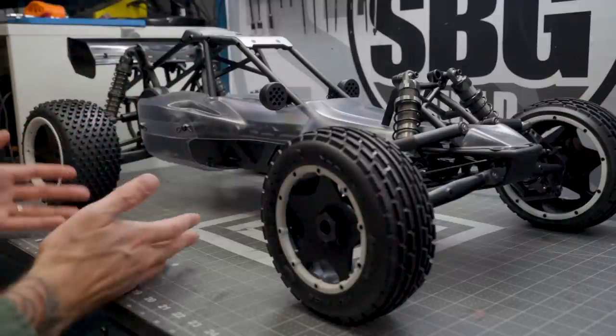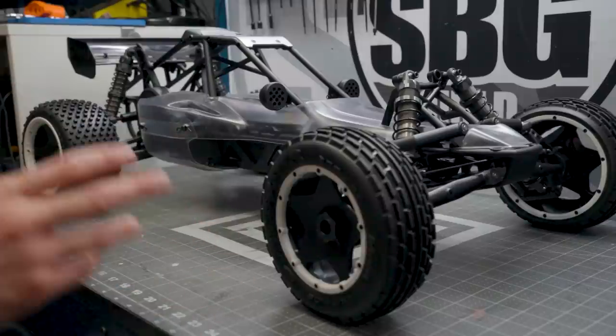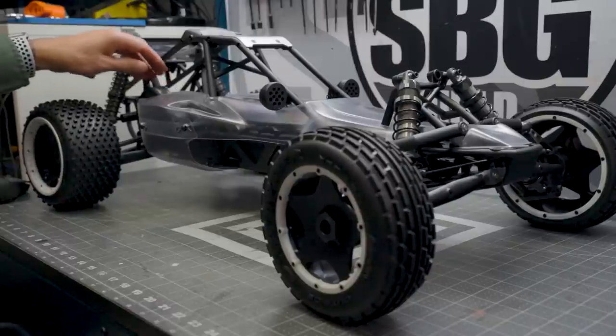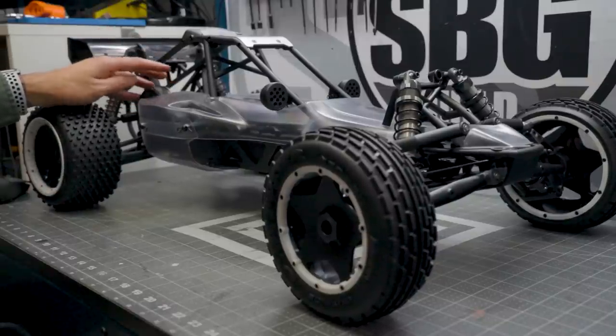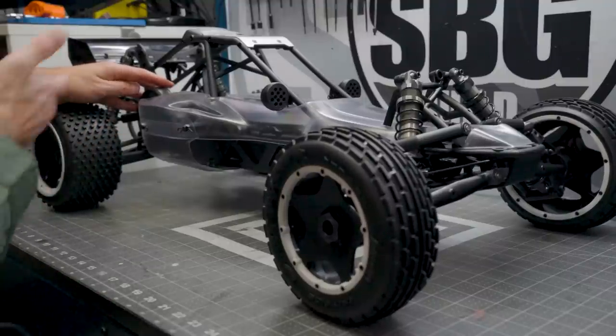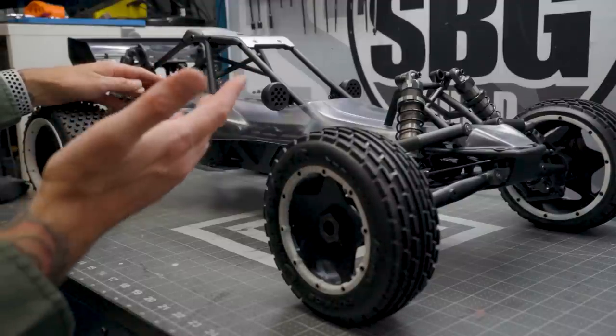because I was doing the electric version. If I was doing the gasoline version, probably much more straightforward. And there are a few mistakes that I made. One major mistake that I made, there is a metal motor mount that is included for the electric Flux version that I forgot to install because there's a plastic one in there and it's obvious that it's part of the assembly instructions no matter which version you're using.